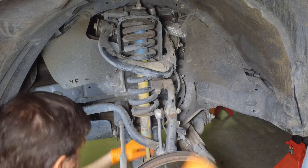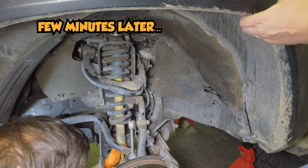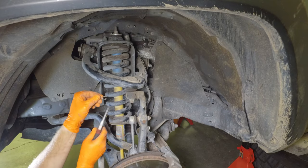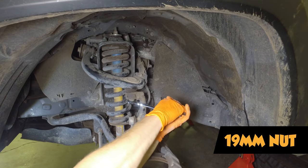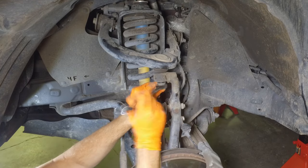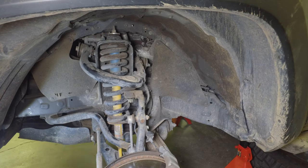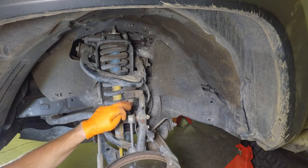Let's see if we can get this bolt out. Now let's see if we're going to have enough room — just enough. We're going to pull this out; you pull it around and it hooks into one of the little notches. Using a 19 box-end ratcheting wrench from GearWrench, we're going to pull that loose. Don't take it all the way off, but give it a little bit of room because when you smack on this, it's going to break it loose and then drop down and stop itself with that nut. I'm going to strike it right here on that spindle and hopefully you guys can see it bounce down when it does.